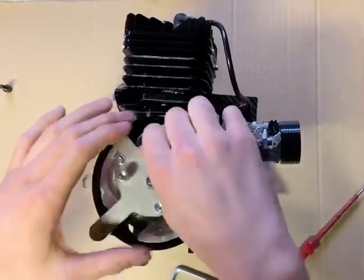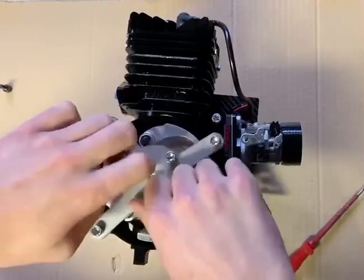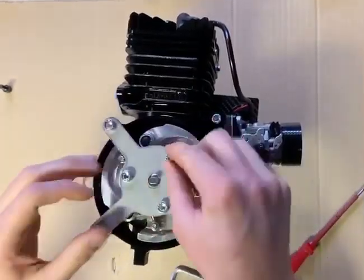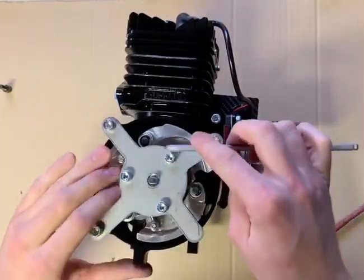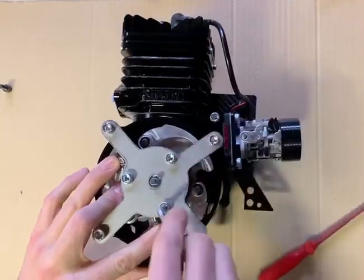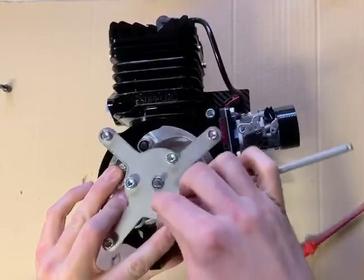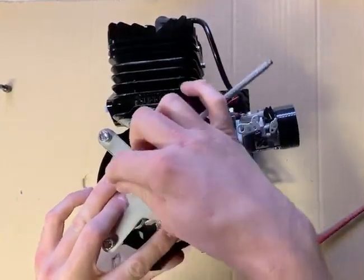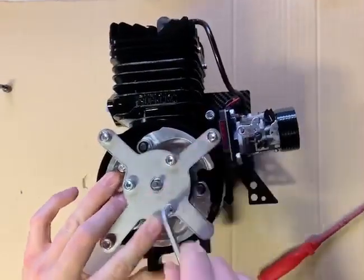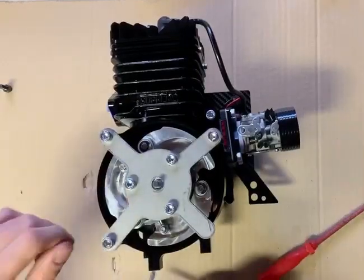And now we just line up the clutch with our 3 main pulling bolts, which are all 12.9 socket caps, nice and strong. The other important part of this is you're going to go around the bolts evenly until you actually pop the clutch off. So just get them all started and then work your way around. Keep doing each one in small increments, just about a flat of a socket cap. There you go, and it's popped off. That's the kind of thing we're looking for. And if you work nice and evenly around each of the 3 bolts, it'll pull it quite simply.